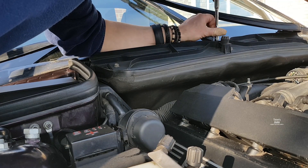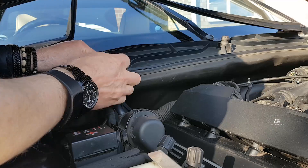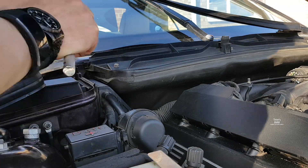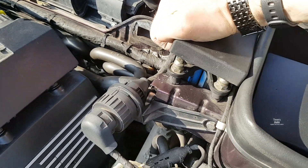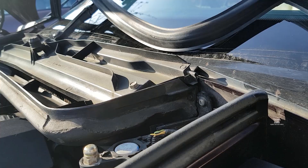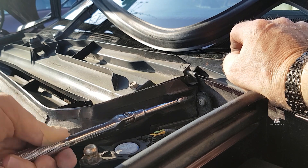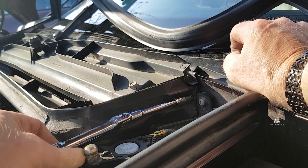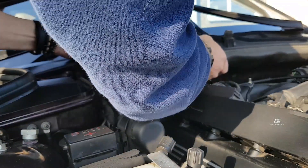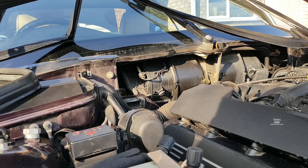On the E31, get the windscreen wiper in the middle — the conical nut, which is nine mil, comes off — and then there are two seven mil self-tapping screws, one each side. The heater valve cover has to come off; I've put magnets underneath mine because they're so hard to get off without breaking them. Here's the other seven mil self-tapping screw coming out, and then the microfilter assembly can come out as one piece, which gives us much more room.